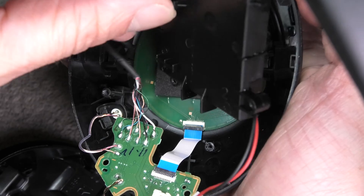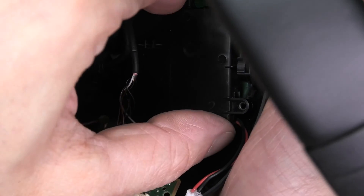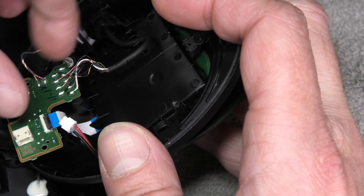As I said before, you don't want to do that at this point — this is too early. First reinstall the battery and screw that back down, because otherwise it's pretty likely you're going to accidentally rip that ribbon cable off again.